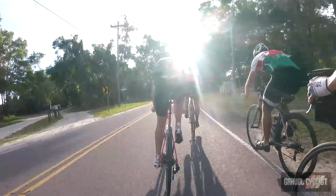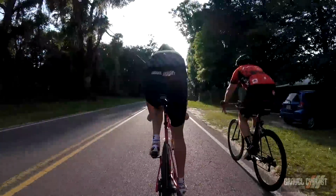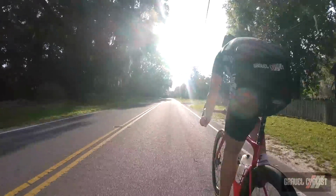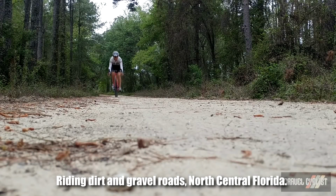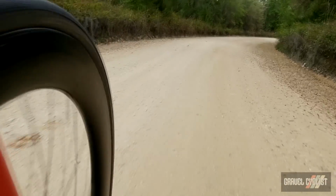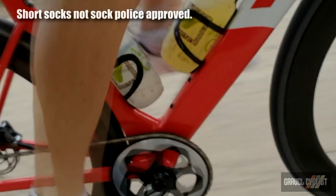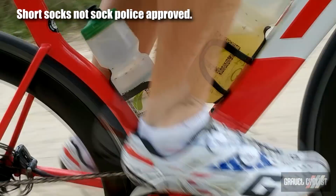This wheel set isn't doing itself any favours by being compatible with tubes only. I was hoping to convert the C60 wheel set to tubeless, but all attempts proved fruitless. Thus, if your 3T Strada Complete bike comes equipped with these wheels, be prepared for some heft and buy yourself a good stash of long valve tubes, or at least get some decent valve extenders. Whilst this wheel set looks good, it was annoying during the 3 or 4 times that I flatted.